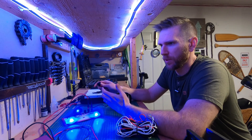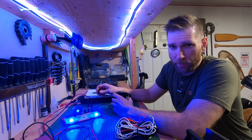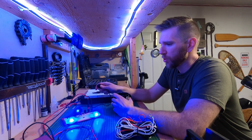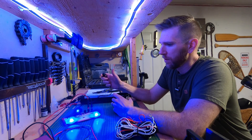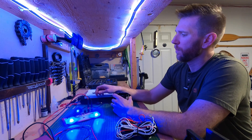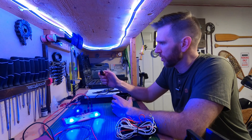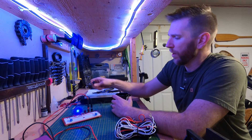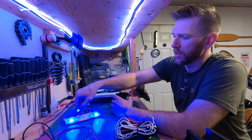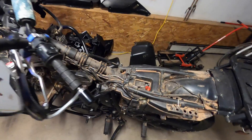It's fairly simple. What this gives you is two LED lights that can be powered directly from the battery but controlled from a constant source of ignition switch supply. This circuit demonstrates those two switches — the switch on your handlebar and the ignition on your bike. If I had these switched on and I turned the bike's key off, they would come off. Let's take a look at how this shakes out wiring-wise.